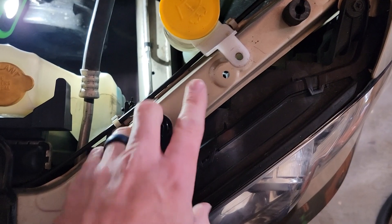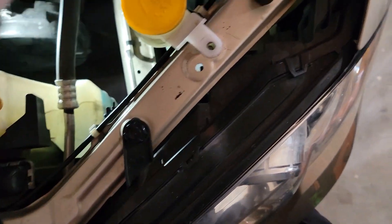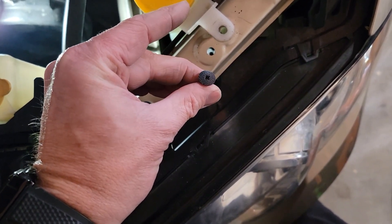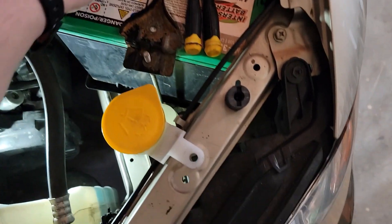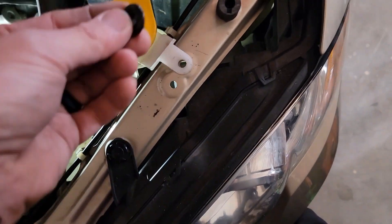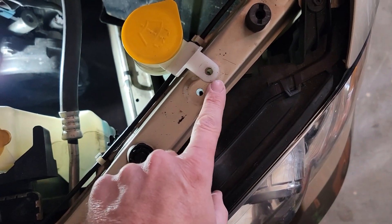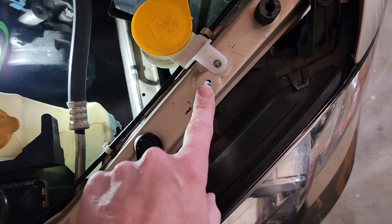It has a plastic cover itself — you can see this gray cover right here. Do one bulb at a time and make sure that the numbers match up. There is a little plastic body fastener with a Phillips head type fitting. You're going to turn it about a quarter turn, then pop it up with a small flat bladed screwdriver and pull it out. Do not pry underneath the whole assembly — pop the body fastener out first.